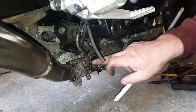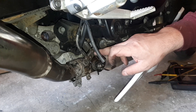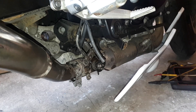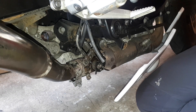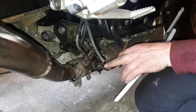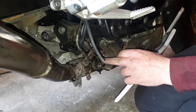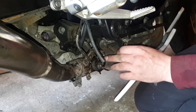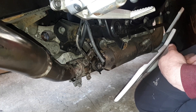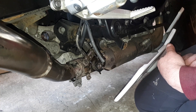I have put the cable pretty much at the same height. Now we're going to put the ignition on and off. What it did — it searched for the end travels. It went all the way to fully open where the stop end reached the stop, then went to the other side full stop, and then came back to the middle. So basically it's just learning its position by itself. You don't have to do any other adjustment.